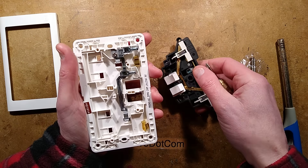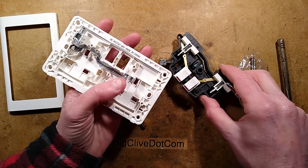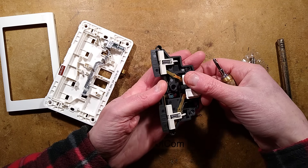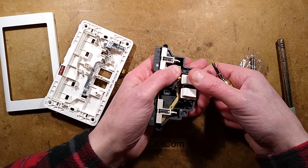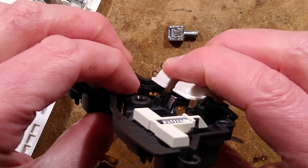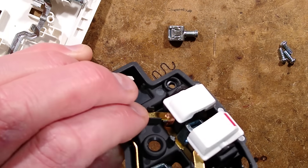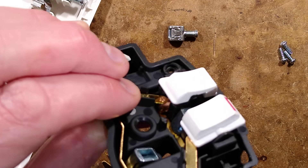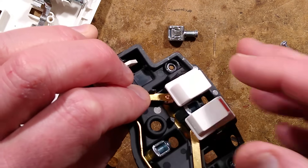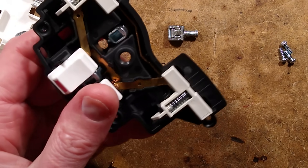It's quite a nice logical construction. As you put it in, everything locks into position. This is an earth bar that comes under here, and that earth bar goes into one of the earth connections in here. Here is what I thought was going to be the problem — the switches — because the problems seem to originate around the switches, arcing inside. But they've got — I'll tilt it up and zoom in — the contacts in there. I can see there's very good clearance.